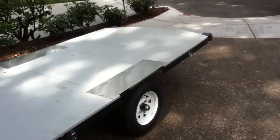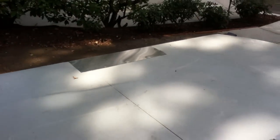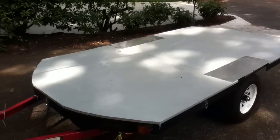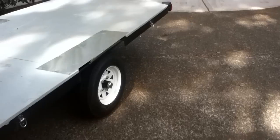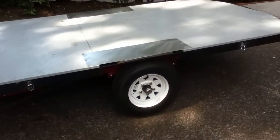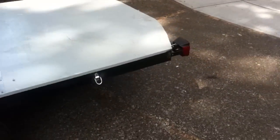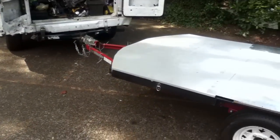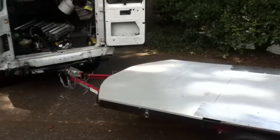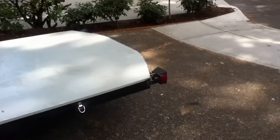It's a true flatbed because I wanted to be able to haul hot tubs and similar loads, so nothing much sticks up — maybe a little bit of edge that I may hit with a sander or grinder someday to round off. The wheel wells are designed to give me three inches of play where the rim goes up underneath, so I maintain full axle travel without giving up the flatbed. I'm still able to maintain a pretty low loading height compared to the van — the trailer bed is still a little lower than the back of the van — and vans generally have a lower bed height than a pickup truck, so it's much easier to load.